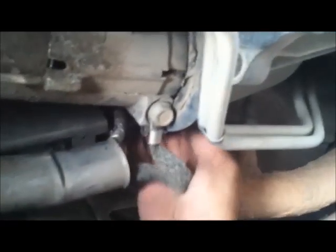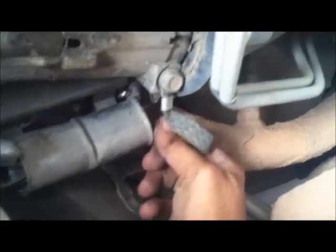It didn't have a good enough ground, so it thought it needed more voltage, so it was overcharging — the internal regulator wasn't working properly. I'm going to take all this apart and reground it with two three-eighths bolts on the backside of my bell housing. Essentially I'm not going to drop my starter — I'm just going to pull the one ground strap, pull this out, flip it back around the way it goes. Somebody got it in there backwards; you can see the bolt holes are on the wrong side — it needs to go up in here on this side.